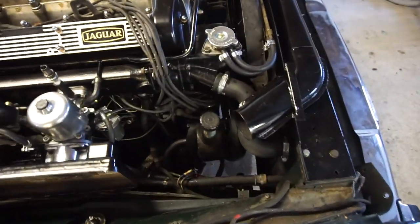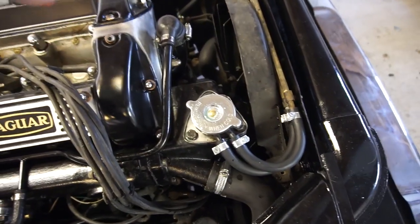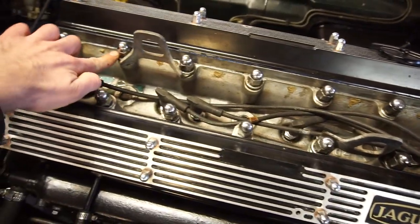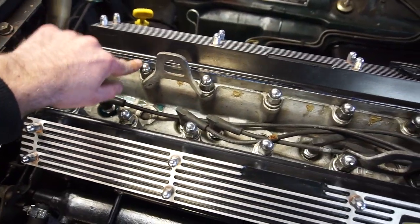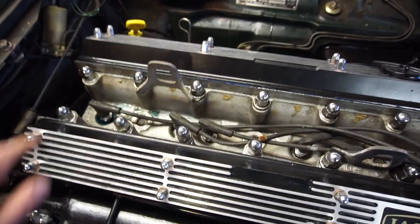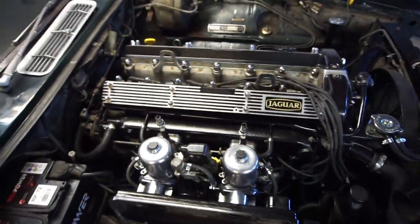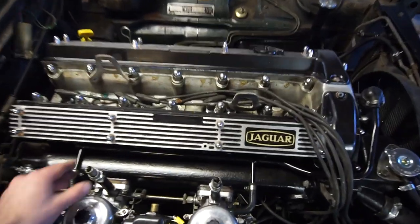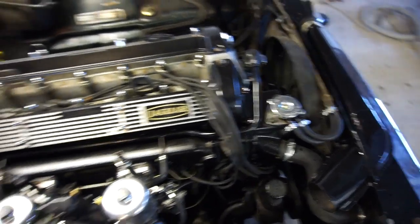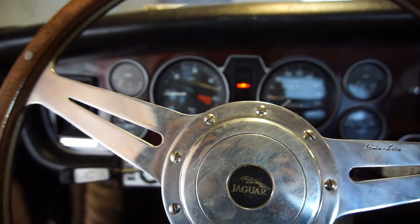There are some weird sounds up here — I think it's the jockey wheel for the power steering making a bit of noise. I took a screwdriver against my ear and listened around the cam chain area — nothing alarming there. There's also a little coolant leak up here which is pretty common after a head rebuild; once I run it up to temperature and re-torque the head it should stop. The engine is still a little hot but I'm going to start it up now so you can hear it run. It's not tuned at all, but at least it runs.